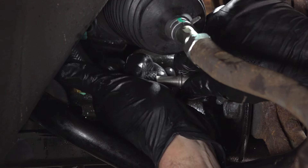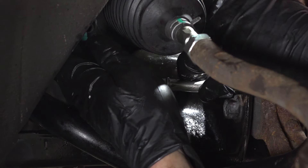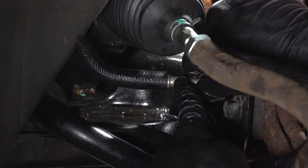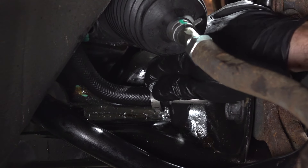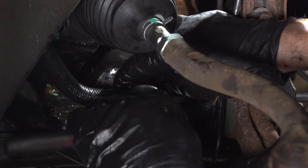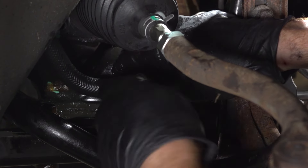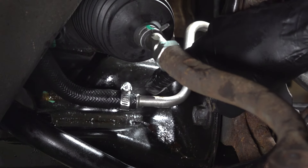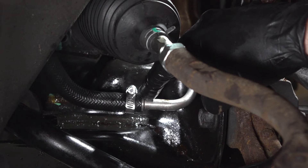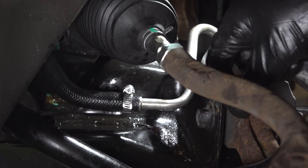Let's get the clamp on there. For this clamp I'll be using a quarter inch socket. If you're using the original, just go ahead and use a 10 millimeter. Before I continue tightening this, I just want to give it a quick inspection. You want to make sure that you can still see a little bit of the hose on the opposite side of the clamp. If you're too close to the end, there's the probability it may come loose and you're going to have a power steering issue.